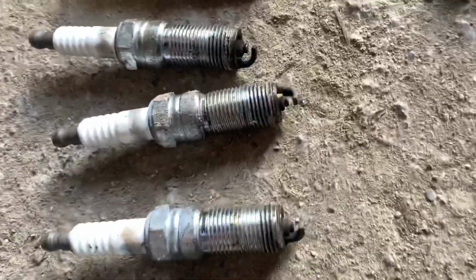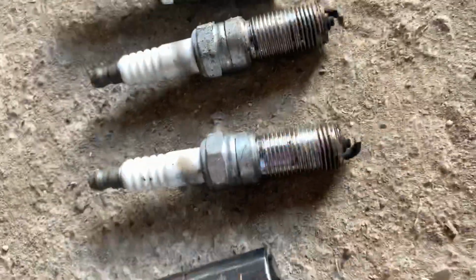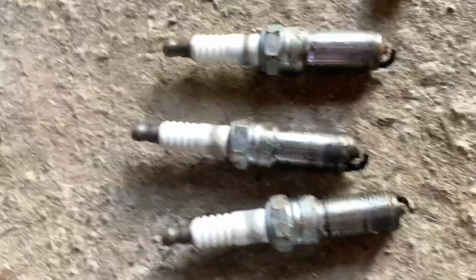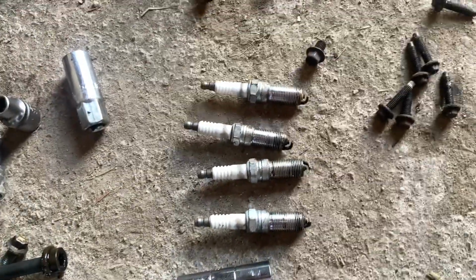But while we're here, one thing that is worth looking at is the cylinder conditions, I suppose, or look at the spark plug wear and colours for looking at signs of cylinder wear and stuff like that. Cylinder two, because it's from the crank, was a little bit of a rich burn, or a cokey burn actually.